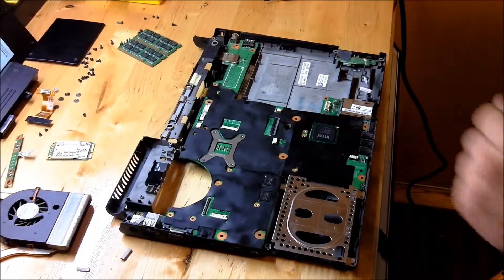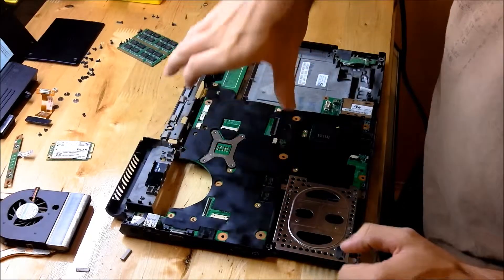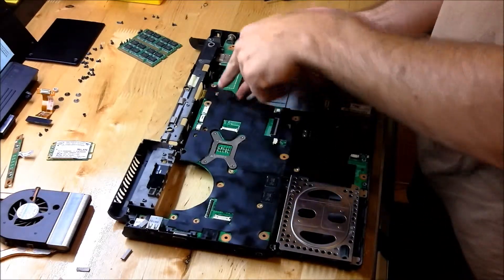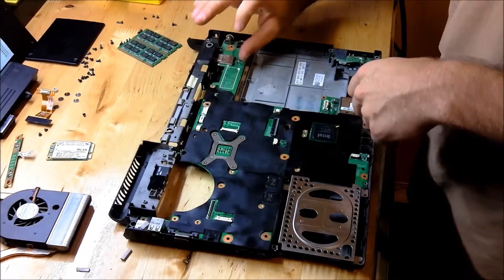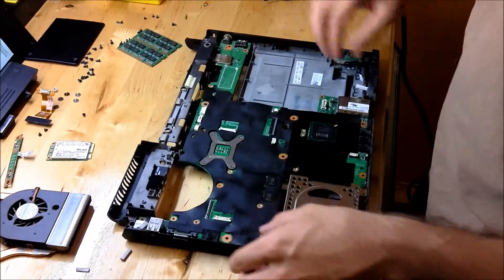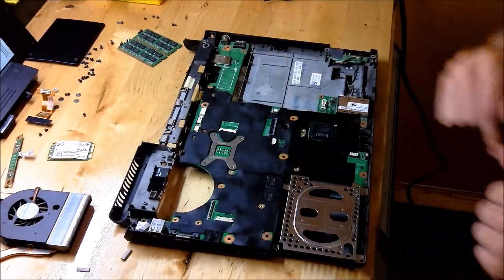The easiest way to get this motherboard in is to connect the daughterboard to the motherboard before you put it in, and then kind of shoo it in like this, and then push it down. You can connect the daughterboard just by pushing them together. Don't push straight down on it, because this board will turn. You're going to need to keep one finger underneath it and one finger like this, and connect it like that. Connect this wire here, and then replace the studs that we removed when we removed the motherboard.